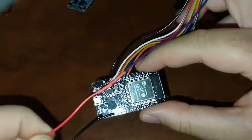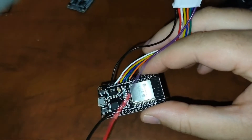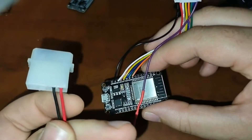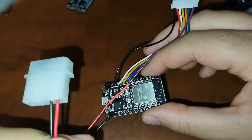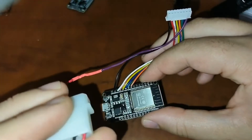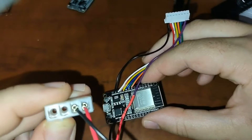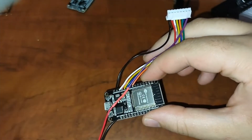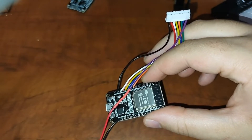The purple wire, which is the outside connector, is 5 volts — I have that connected straight to a Molex. The reason I'm using Molex is because we're only using the 5-volt side, not the 12-volt side. With the Molex connector you can just pop out the 12-volt side with a paperclip. You can't do that with SATA, because if you cut them off you end up with cut wires that could possibly cause a short.